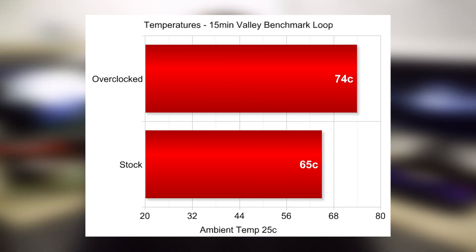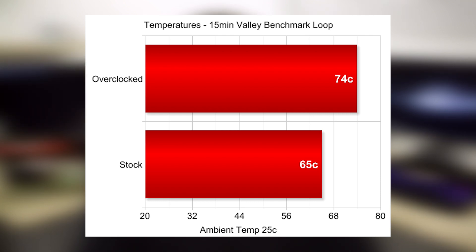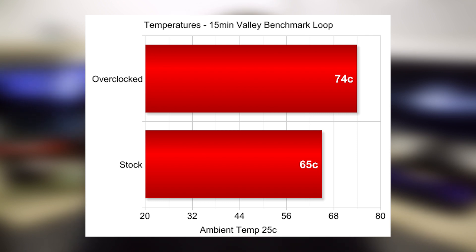The max temperatures with this cooler — it's very, very quiet, never going higher than about 50% on the fans. With the stock max overclock, the max temperature was 65 degrees Celsius, which is a few degrees hotter than advertised, but I live in the desert and it was 105 degrees Fahrenheit today, so the difference is entirely due to ambient temperature. With my full overclock up to 1150 MHz, it reached 74 degrees Celsius — still very manageable, and the cooler still had lots of headroom. Kudos to VisionTek on that very beefy cooler.